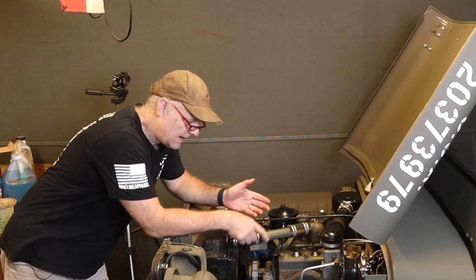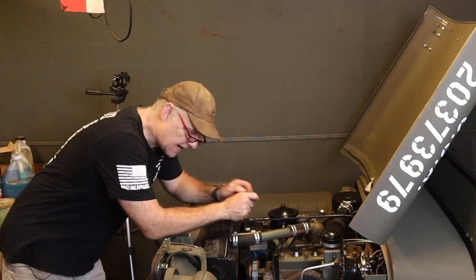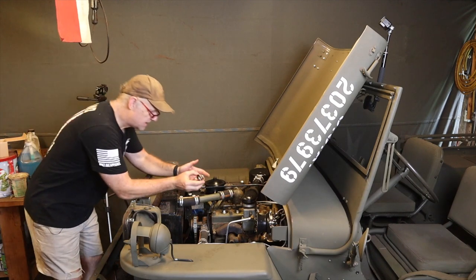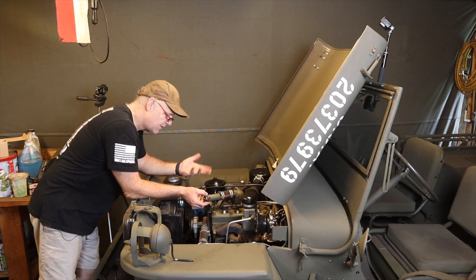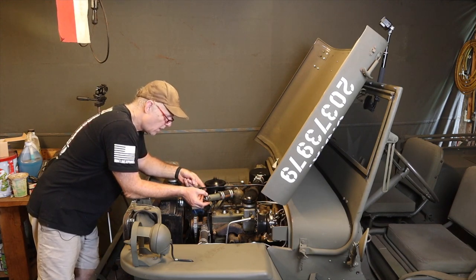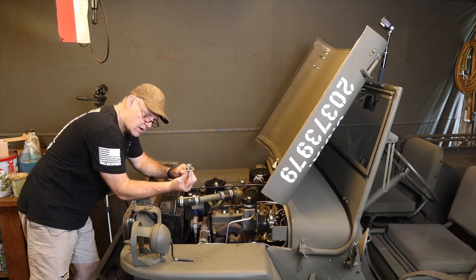You start your motor up, and there is coolant sitting in the block. There are passages in your engine block that have the coolant sitting inside of them. And the thermostat, which I've actually already removed and I'll show you. So here's the thermostat, right? So what's happening? We start our motor. The temperature inside of the block is cold. The water temperature is, again, whatever the ambient air temperature is. Let's say it's a nice warm summer day, so it's 80 degrees or something like that. Combustion starts happening. Of course, it's much hotter than 80, and the water starts heating up. Now, the water pump is pumping the whole time, but it can't pump anywhere because our thermostat is closed.